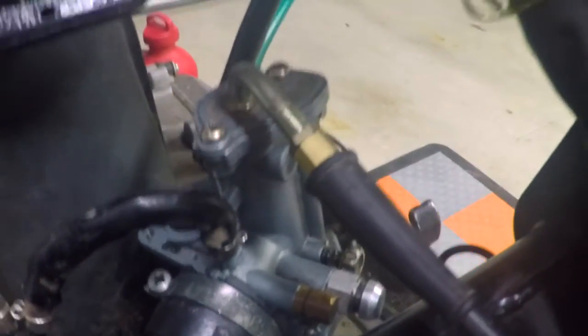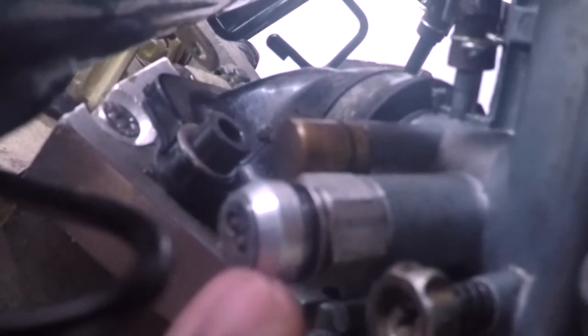I'll move to the other side and show you a little bit of what I did. I just put a valve on to have some on/off. There's no reserve — the reserve is going to be indicated on the gauge. I had to cut off a piece here from the evacuation tube, so it's kind of hard to get to, but you can still drain the carb if needs be. There was a temperature sensor — I think for the choke — I just cut it off. It's shut, it's fine.